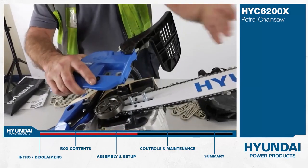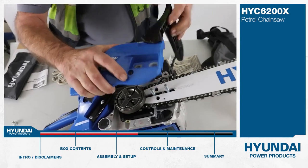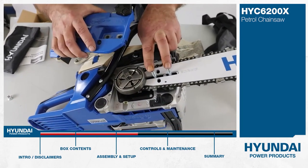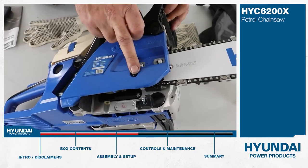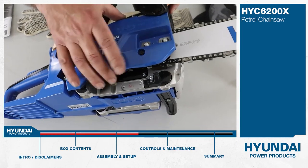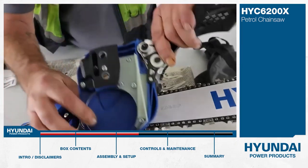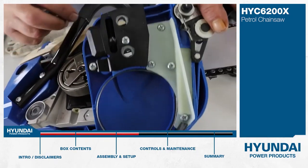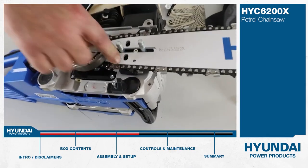Now we need to make sure that the brake is in the off position first of all. That's back, okay? Now a couple of things that are important here. Obviously these 2 screws have to pass through these 2 holes like this. But another point of interest here is that the adjuster, let me bring it into shot for you, this pin here, when we put it together, needs to line up with this slot.